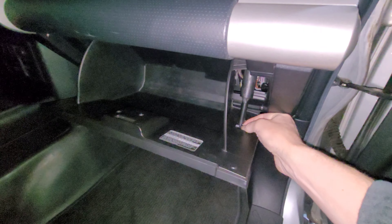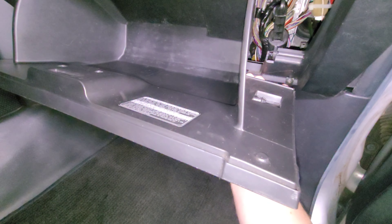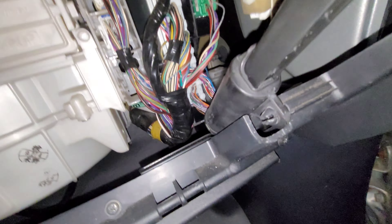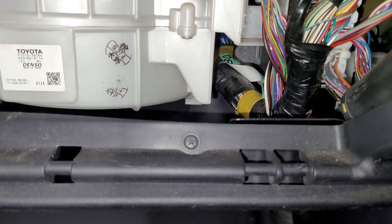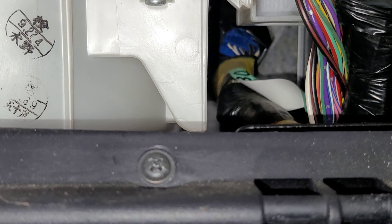Pull out your glove box, remove the little shock, pinch the end, and pull the shock off. Pull the bottom forward so it unclicks both sides, pull in the stops on either side, and then slowly withdraw it — the whole glove box should come out. That'll give you better access to the B45 connector. Here's the connector we're looking for — look way down here, and it's that blue connector right there, which appears to be covered in tape.